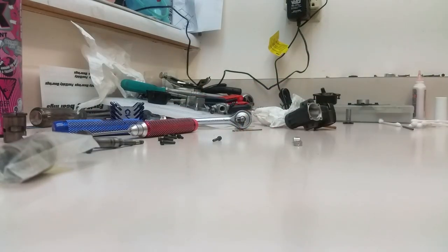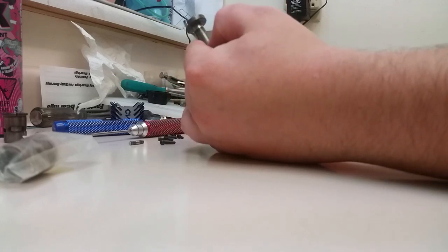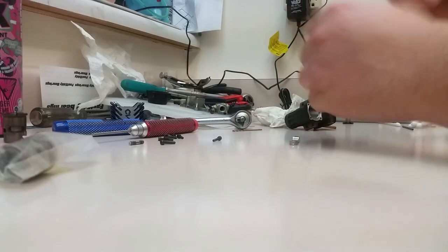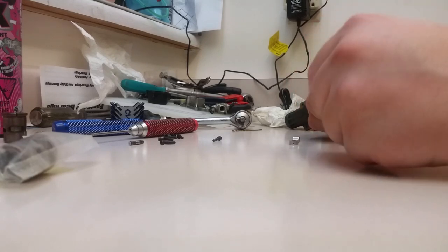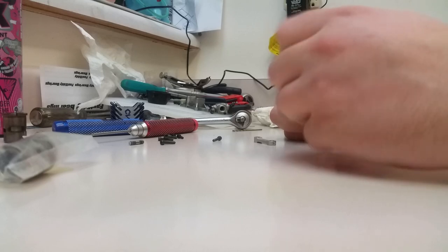Okay. So next, this crankshaft might look bad, but you can't feel anything on it. There's no scoring or scratching. It's just stained from being 20 odd years old. So we're going to hit that with some brake parts cleaner and clean the center of it out with a Q-tip. Because oftentimes the center of your crankshaft can be quite dirty. Not a lot of people think about that.